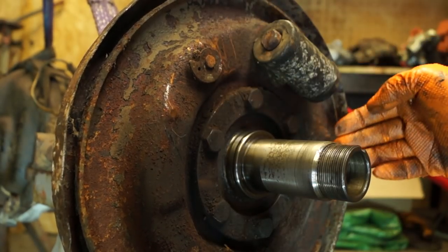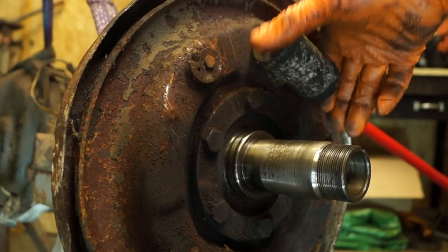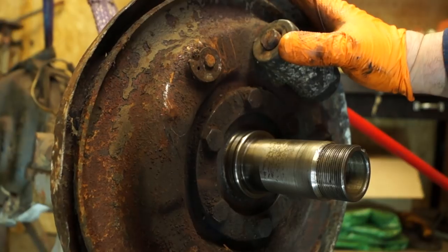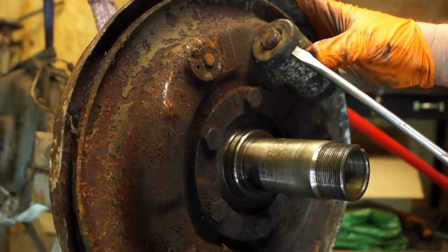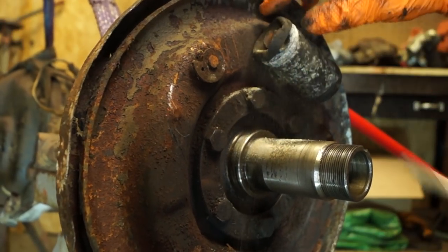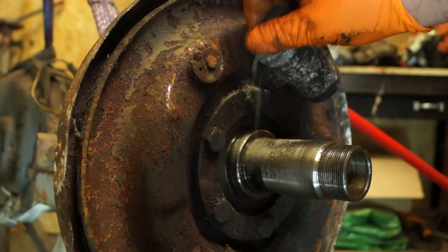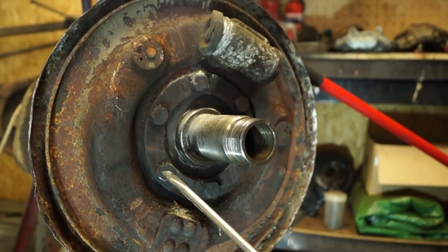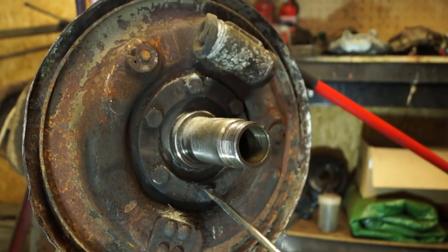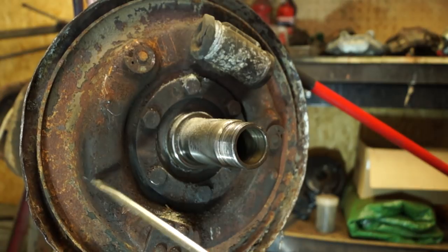The backing plate, we're going to take off. It has adjusters which can seize up and wheel cylinders that can fail — like this one, which is absolutely solid. I'll pull this off to show you underneath: it's bone dry — that's screwed, so that needs replacing, which is an easy job, only two bolts holding it on. The back plate is held on by six bolts which also hold the stub axle on — nut and bolts. Once they're undone, the backing plate can then come off.